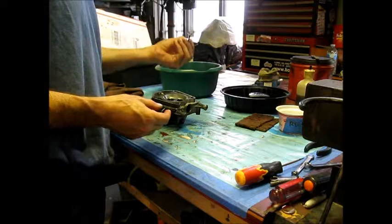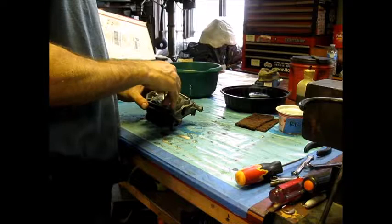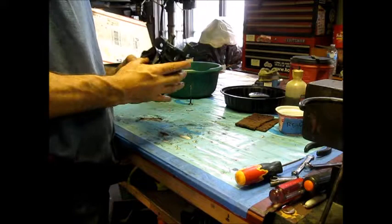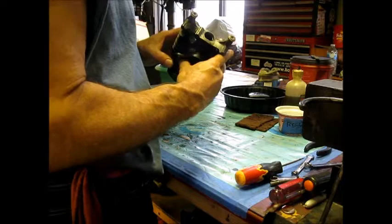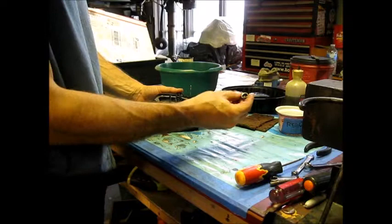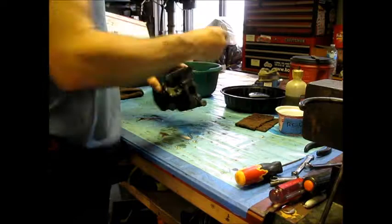So the one in my left hand is the exhaust, this is the intake. Let's put our intake here — looks good. A little light oil down there. That's not getting stuck on a valve stem anymore. Let's drop a spring down on it. I'm holding it with one hand and I've got a finger holding the valve up, and this is slotted. So we're just going to push that down and pull it over — and that's it.